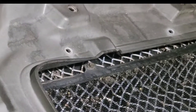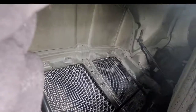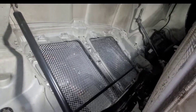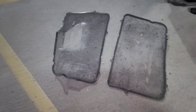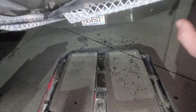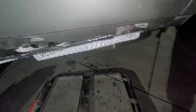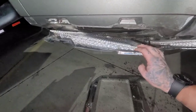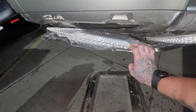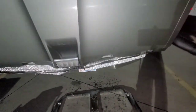There's a bolt right there. I'm going to go do the same thing on the other side — this video is already getting long enough. Driver and passenger side bug screens have been removed. You can see they're pretty jacked up — you really don't want that, so you don't catch rocks. There's a ton of bugs that were in there. The issue is bolts that are either seized or stripped and broken off — probably because I was using an impact wrench on old bolts. I'm going to clean this up a bit and try to get some penetrating oil on some of these seized ones to see if I can get the rest off so it can go back together without falling apart.